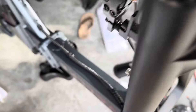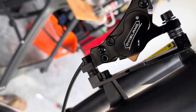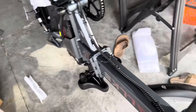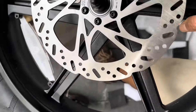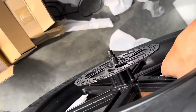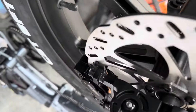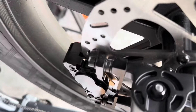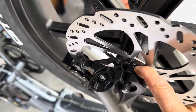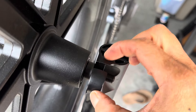I'm going to put the front wheel on between the disc brake — wow, look at that. The brake rotor is 203mm, motorcycle grade. When you drop the wheel into the fork, make sure you align the brake pad with the 203mm rotor. You have inside washers — one between the wheel and the fork on each side.